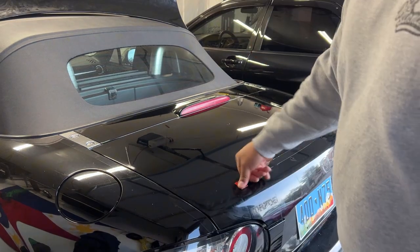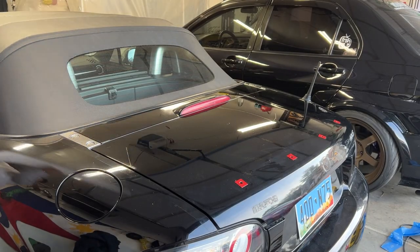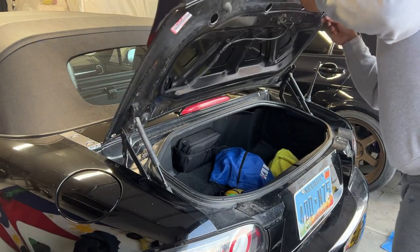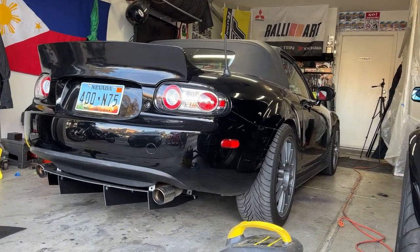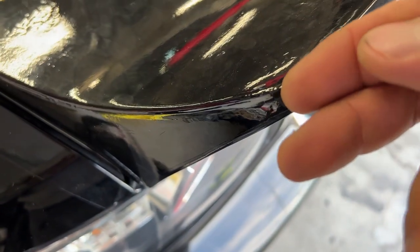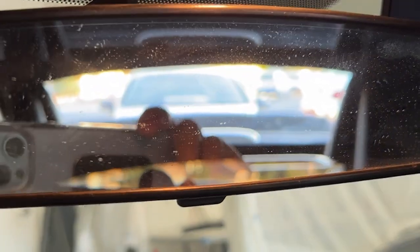Before securing your spoiler, I recommend you apply some primer to your drill holes where the raw metal is exposed. I also added a gasket between it using only one side of one-inch wide 3M ultra strong double-sided tape, cutting a circle in the middle and applying it around each mounting hole. We got them all in - nice and solid. No complaints there, I don't think that's coming out. Wrap looks really good - for the first time trying to do something this curvy, I'll take it. Looking out the back from inside the car - not as bad as I thought it would be. Only loses about two inches of visibility, so no worse than before.